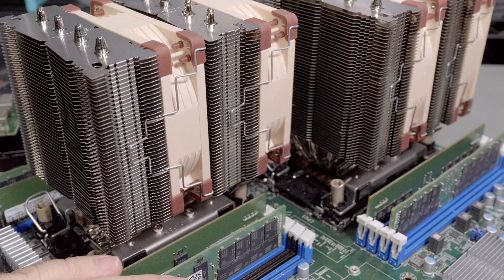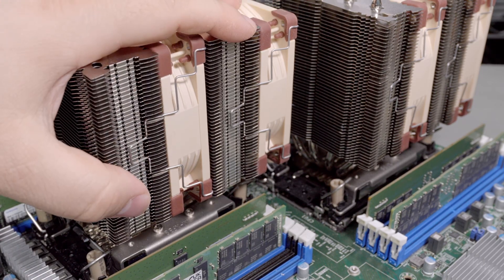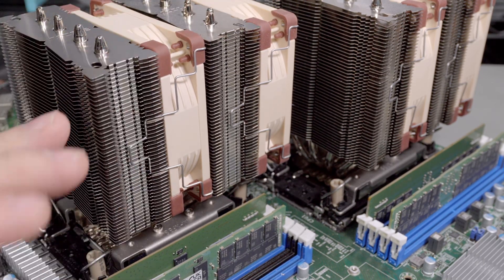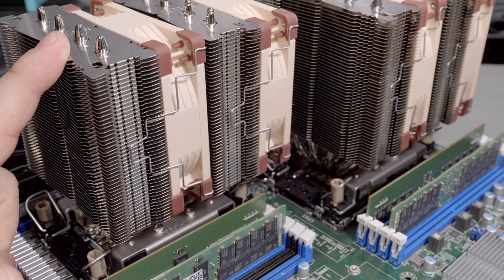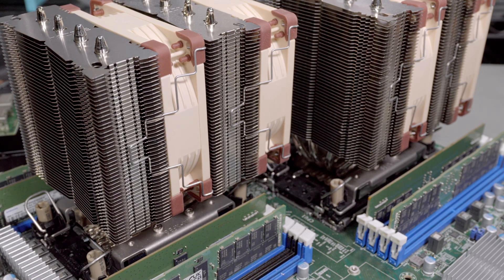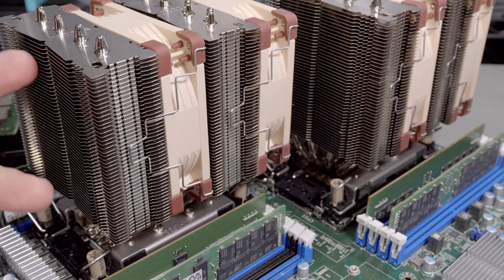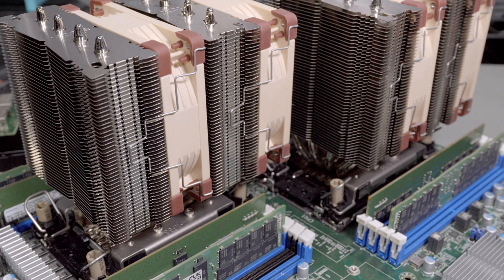I was waiting a bit before doing this video because I had a Supermicro fan and heatsink on one CPU and I wanted it to match. I like Noctua, so I bought a used one — open box that some guy tested and found didn't fit his case, so I got it at a good discount. I'm going to have all those fans running into the Corsair Commander. There are Linux tools to control the speeds — I don't need fancy control, just set it to like 70% and leave it there.